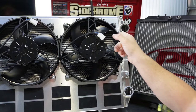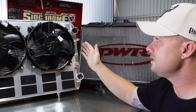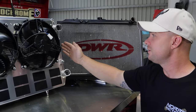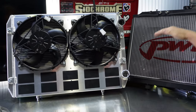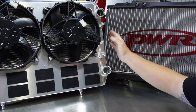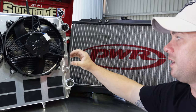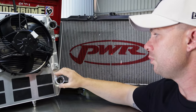In the new radiator, the hot water comes back from the engine into the side tank and then does a double pass - it goes up one way and then back the other way and out. The side tanks are a massive cosmetic plus because you don't have those ugly tanks at the top and bottom. With tanks on the side, we clear up a lot of room and the core is essentially bigger - so instead of a small area you end up with a lot more room.